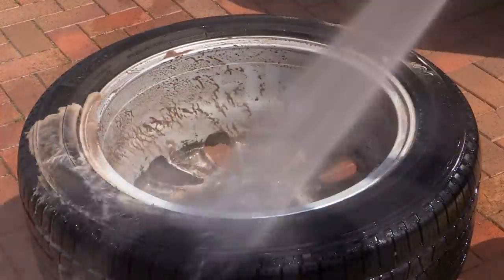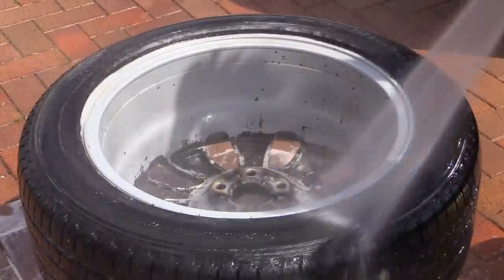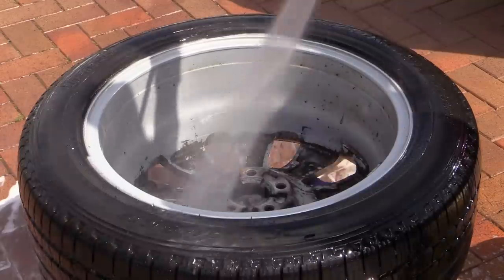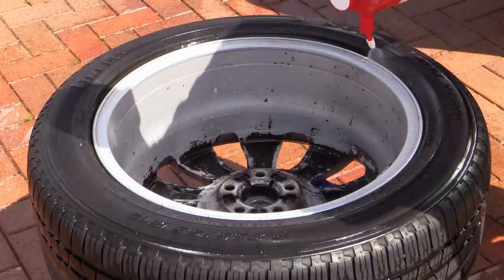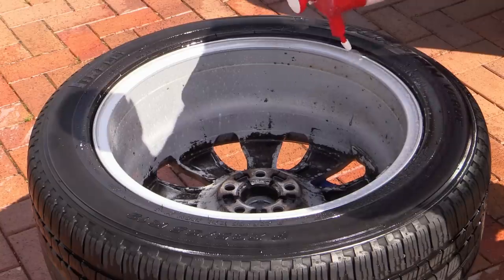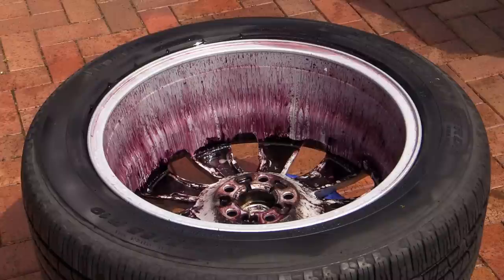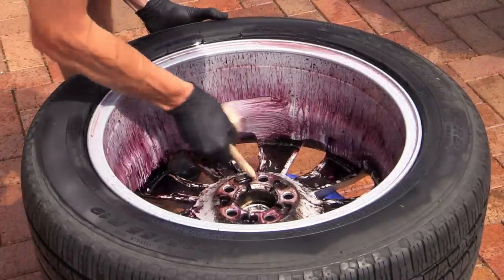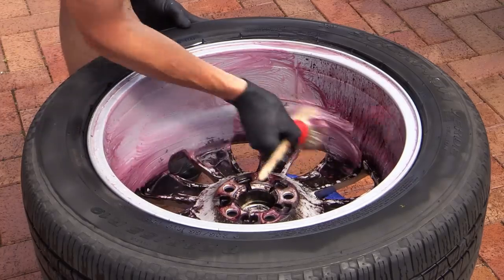The wheel cleaner and heavy physical agitation probably shifted about 50 percent of what was left on the surface following the pre-clean, but as you can see there was still a fair amount of stubborn spots and stains present, especially on the backs of the spokes. So to address that, I switched to a straight-up bleeding fallout remover, which I hoped would reactivate some of the splattered stains that were likely caused by the use of a similar product in the first place. After being applied and left to soak for a few minutes, the wheels began to bleed heavily, indicating an abundance of iron and metal-based contamination that any other product would have struggled to shift. As before, all surfaces were then agitated with wheel brushes, which helped make the most of the potent product and take the clean to the next level.